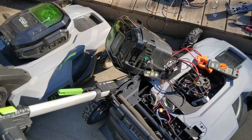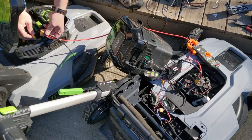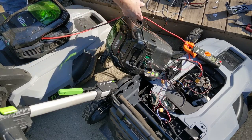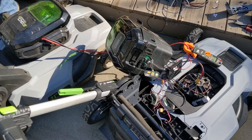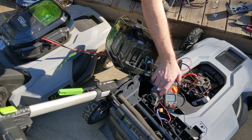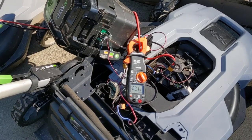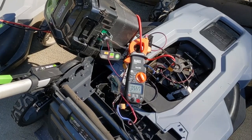Of course this is bypassing all safeties — this is for troubleshooting and testing only. I bet the startup current is going to be very high on this; it's probably not good for the battery fuse honestly. With no brakes, it coasts down. At least our motor runs. So the next test: I'm going to bring over the twin sister of this mower and hook up out of its controller — it should be identical. With my XT60 extension, the control from my working mower is feeding over to this motor instead. All safeties are intact on my mower.